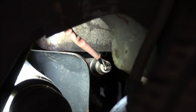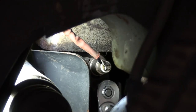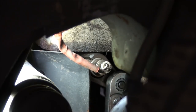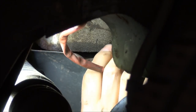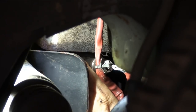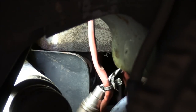You can see the O2 sensor right in there. I'll sneak my 3/8 ratchet and socket up over the wire and put some pressure on it. It broke loose easily — great. Now I'll reach in, unscrew it by hand — it's a little stiff. There we go — it's out. I'll pull it up through the top.